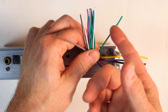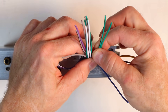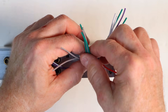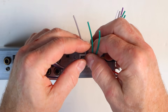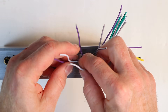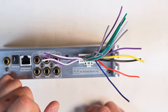Even though these colors look like the standard colors you'd see on a radio, make sure you read the chart on the bottom to match them up. Input for channel one is the pair of purples, channel two is greens, three is white, four is a set of grays, five cycles back to green, and six is gray. Off to the end there's a set of purples and whites with no connection — they've just filled the plug, so you wouldn't be using those for any installation.